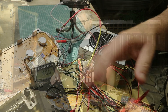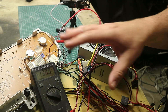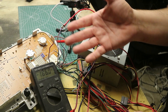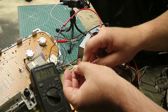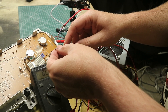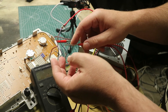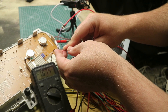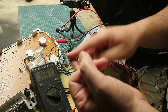We're going to take advantage of that by measuring the voltages on each wire with a multimeter. Find one which is around three volts and one that's around two volts. The three-volt line is CANBUS high and the two-volt wire is CANBUS low. On the multimeter, we've gone through all the wires and established these two — a red one and a white one — have different signals to the others. The white one measures 3 volts and the red one measures around 1.8 volts, so we establish the white is CANBUS high and the red is CANBUS low.